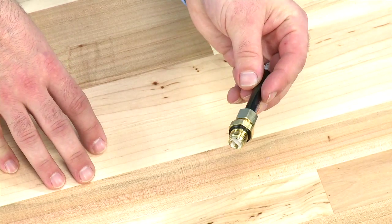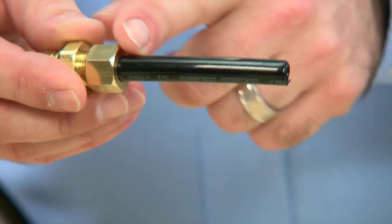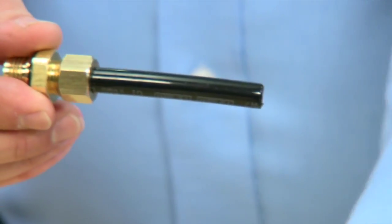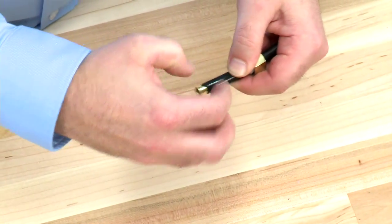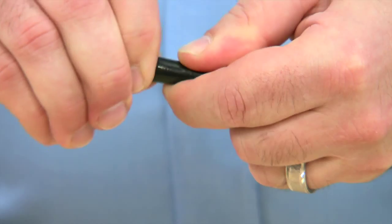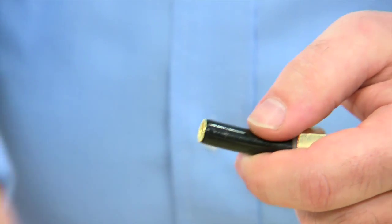Make sure to use silicone lubricant when placing on a new o-ring or reinstalling this component. We can then look to the hose to make sure there is no damage to it. If the end shows scoring, we can loosen the nut, remove the tube flare, and trim the hose. We round off the hose, place our connector back in, and reconnect.